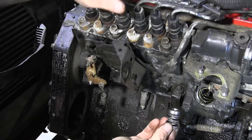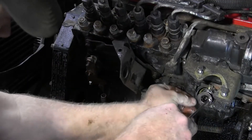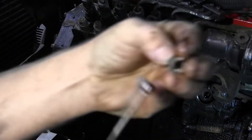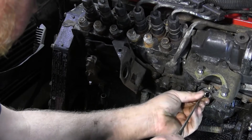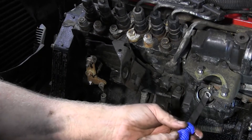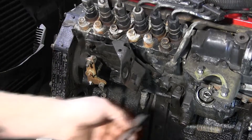We won't be reusing any of those old parts. Here's your base, here's the intermediate spring, and the big spring that comes with the Power Driven Diesel kit — we left the little spring out. I'm going to tip the base right into place, put the retainer back in, and then thread the retainer nut on using the magnet. That's on there enough it can't fall off.